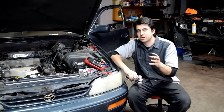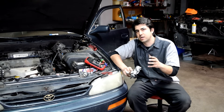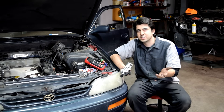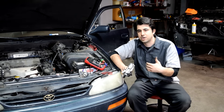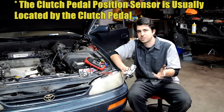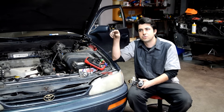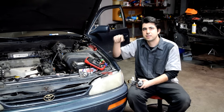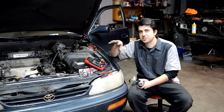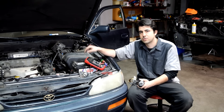Your neutral safety switch is usually located on your transmission if you have an automatic. When it gets the signal from your ignition switch, it will only let that signal pass if your transmission is in park or neutral — for safety so you can't start the car in drive or reverse. A clutch pedal position sensor works in the same manner and won't let you start the car unless you press the clutch to the floor. From those switches the signal travels to your starter relay. So check the relay, then your ignition switch to make sure voltage is coming out on the correct wire, and last but not least check your neutral safety switch or clutch pedal position sensor.